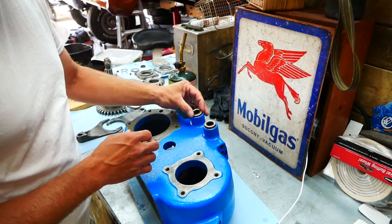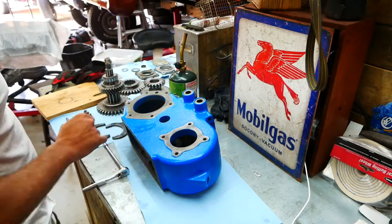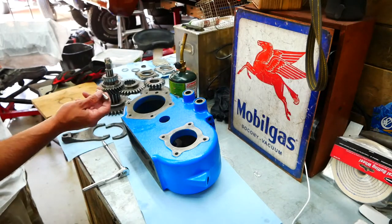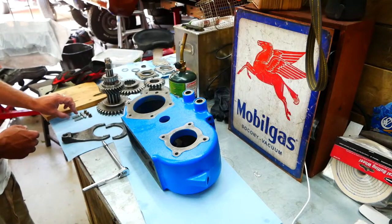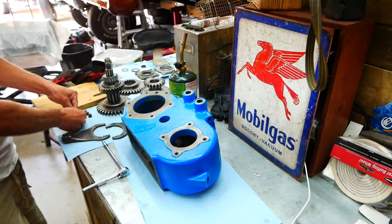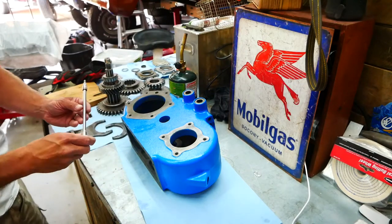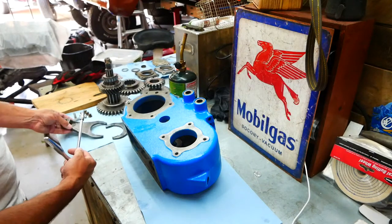Next we want to put our shift rails in. Grab your seals first — I'm going to use a 19mm socket and drive these in as straight as you can. After you put your seals in, we're going to put the shift rails in. This is a J style shifter — you can have the T style which is an earlier case. Most T cases come with two detent rods; most J style cases come with one. So I've got my one detent rod, my two detent balls, and my two detent springs — one is noticeably heavier than the other, which will make a difference when you go to put those in. Plus your two shift forks, which should have your allen-headed keepers in them. The tool I'm using is a quarter-inch drive with a long shaft, quarter-inch socket, and a three-sixteenths-inch hex.